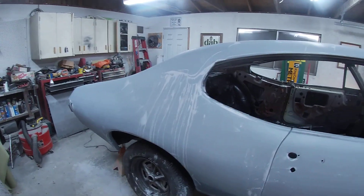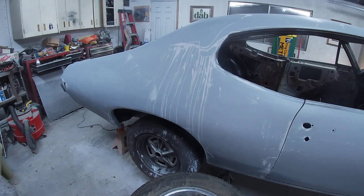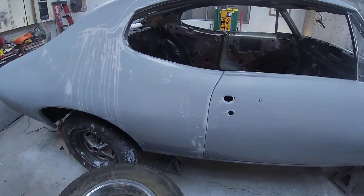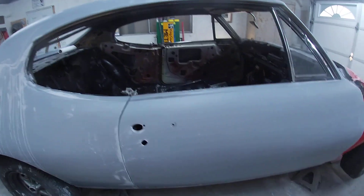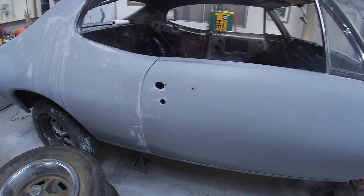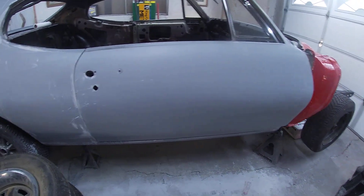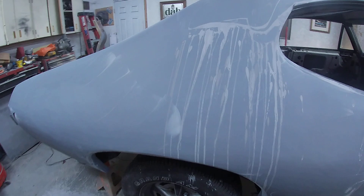The semi-gloss black looks great. What you see on there is just sludge from wet sanding — about to clean this thing up pretty soon and finish it up. Getting her ready for paint. All the bodywork is done, all the major stuff. I'll probably do some dolphin glaze on a couple little pinholes I found here and there. This door was pretty bad — just blocked the snot out of it.